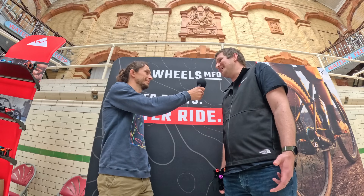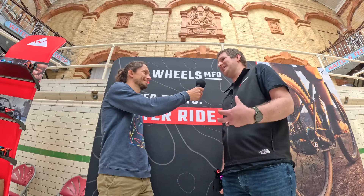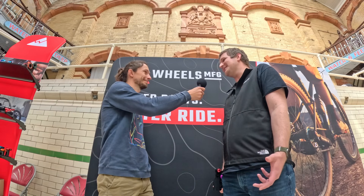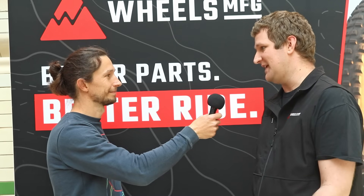It's kind of complicated, like most things in the bike industry. The bike industry doesn't like standards that much, and my belief is it often gets left to the last minute in the frame design process. Bike companies will design a frame and then at the end of the process say okay, we need to put the derailleur in this position relative to the frame, and so they will make a bracket to fit that distance. Some companies are pretty good at reusing old mech hangers — Trek is a good example of that. However, SRAM and Shimano will, five to seven years down the road, change the standard, so Trek would have to go back and update the mech hanger to match the new positioning of the derailleur, meaning even when they can reuse hangers they eventually have to update them anyway.